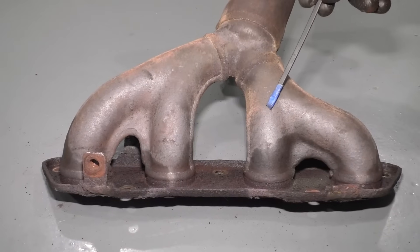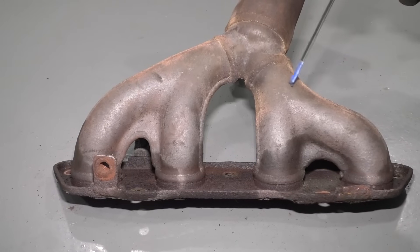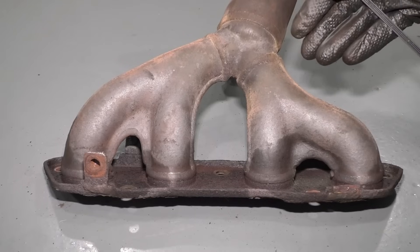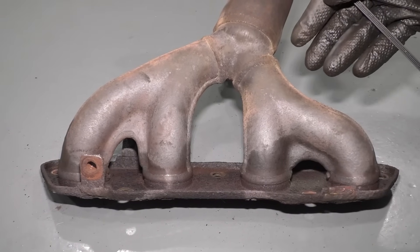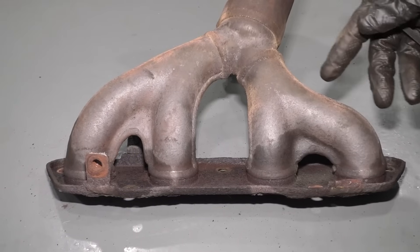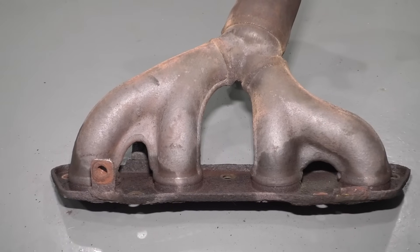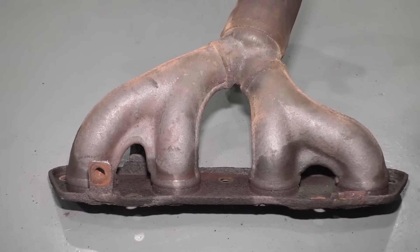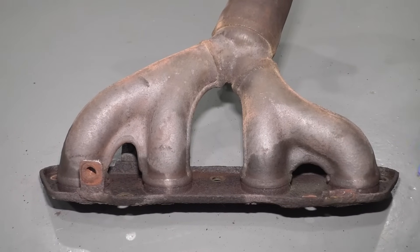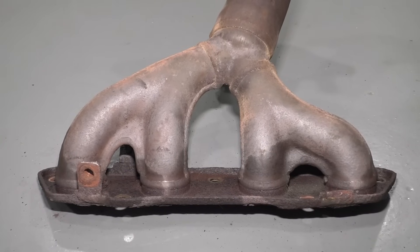A common reason why you might find a hairline crack on your manifold is because of how much heat is actually coming to these manifolds. There's a lot of heat created inside the combustion chamber and it gets forced out directly to your manifold, making this one of the hottest parts of your exhaust. Think about how hot this gets and then it cools down when you turn off your engine — you start it back up, run it, rev it up, and then it cools back down. Hot, cold, hot, cold — back and forth. Metal's expanding and contracting as that's happening, and you might find that you have an issue.